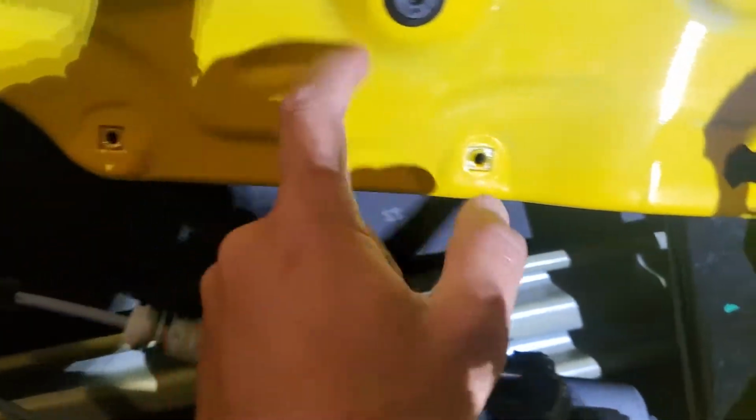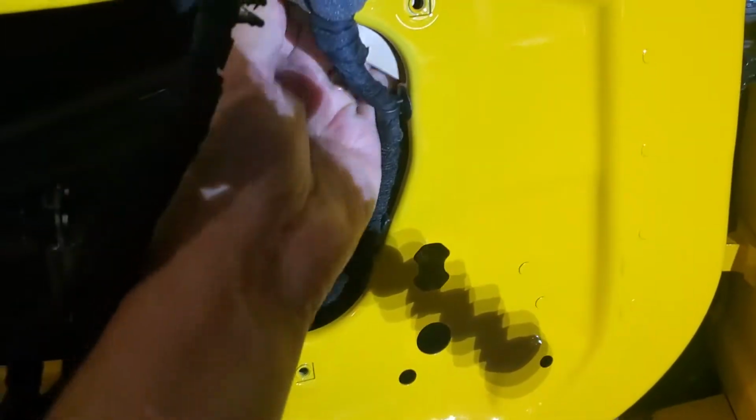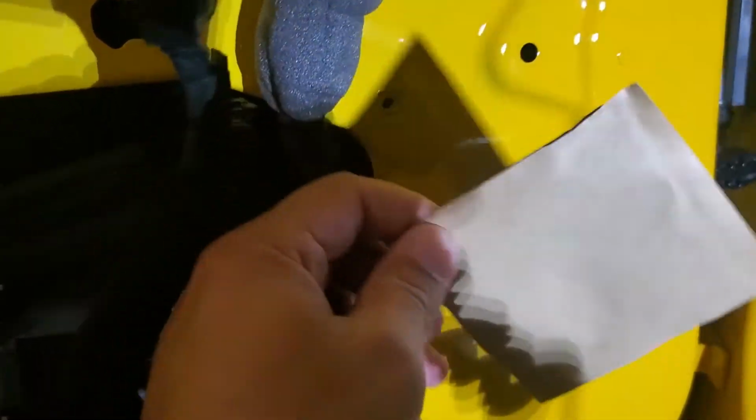I'll show you something here, what I'm talking about doing on the inside. So I layered a little piece here. You hear this, and I'm just fitting a little tiny piece like this up in here and squishing it down just in this area. I don't really have to worry about that hurting anything or blocking any holes, especially like this hole. And it just helps. Every little bit helps. You don't have to do a full coverage on this metal. This will absorb the energy around it and transfer. Basically, it turns vibrations into heat, which reduces rattles, which makes the sound level lower, stuff like that.